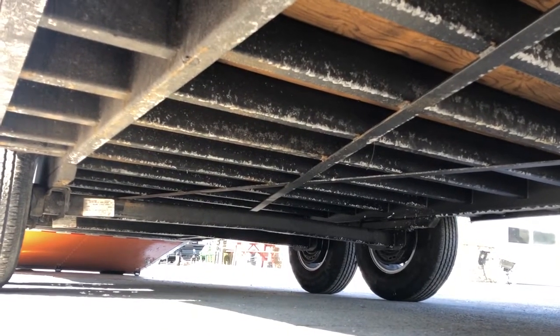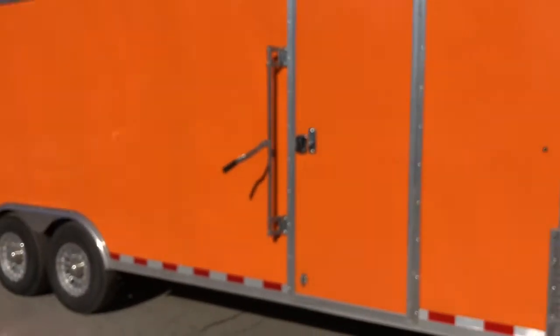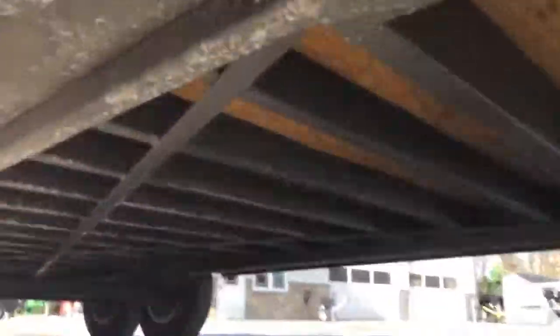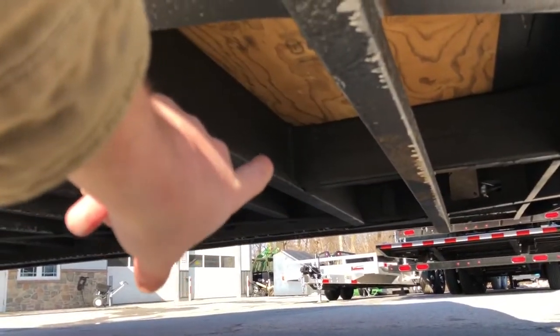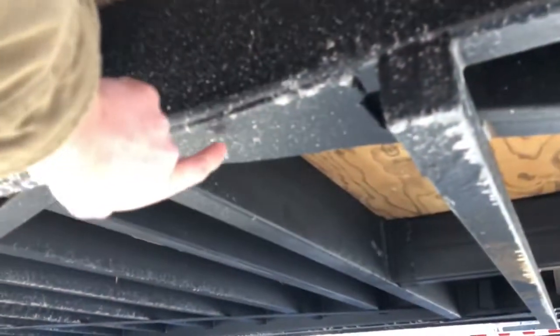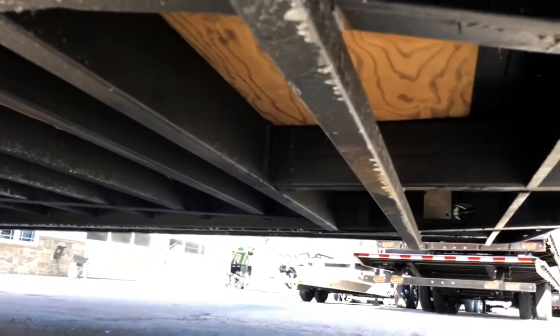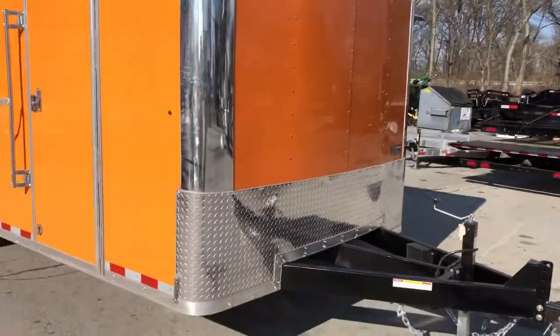There's your torsion suspension. At the back end of the trailer, they use a tube rear sill, not a formed sill. The outriggers they use are also made out of tube — many in the industry make them out of formed material. They use a tube header where the trailer headers up and the triple tube tongue comes together — that's all reinforced and gusseted. Many manufacturers will use a formed header there, which doesn't lend itself to giving a lot of strength. They put a lot of time into thinking this trailer through, with extra reinforcement not typically found on cargo trailers.